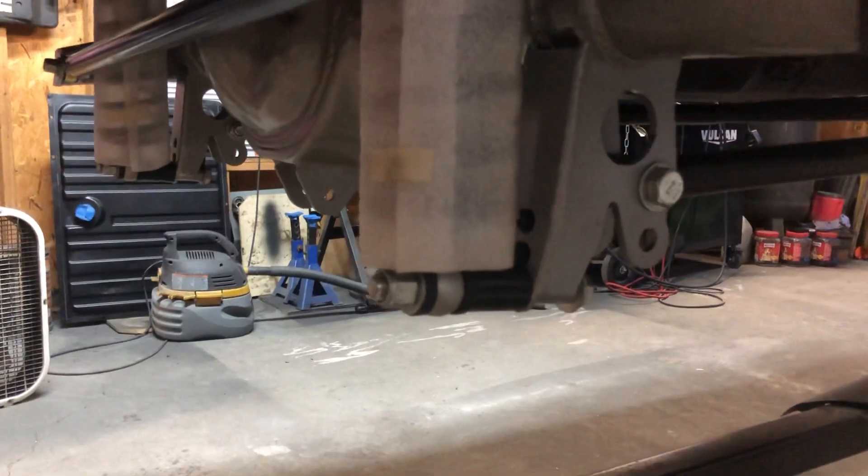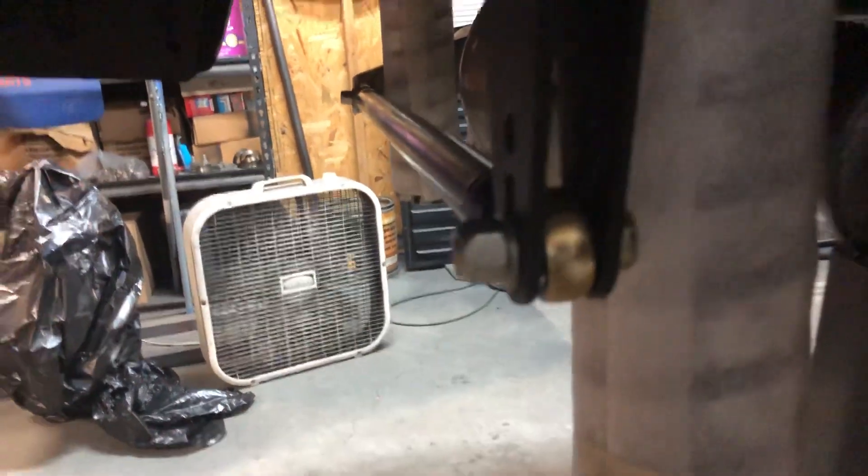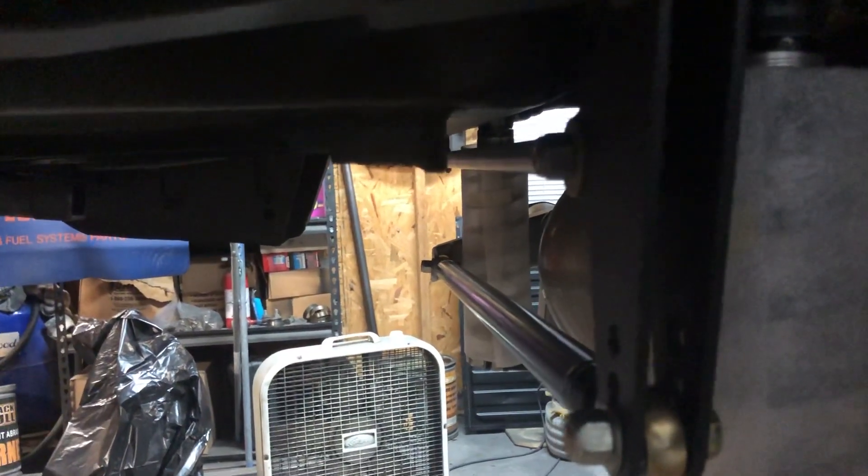Anyway, that's where it's at. The rear end is bolted up, good to go, tightened down. One other thing I noticed: this bolt right here is a quarter inch shorter than the other one. I don't know which length was supposed to go back here, but this seems to work because this side clears — there's actually a gap between the drop pan and the trunk. The other side is literally just flush with the nylon, and it was needed because of that gapping I had to do over there for the mini tub frame rail piece to fit.